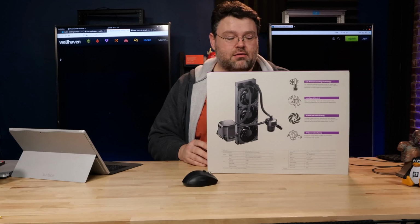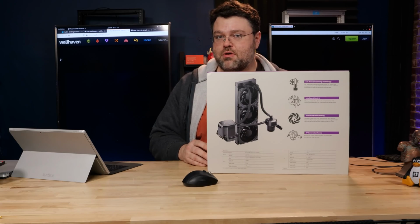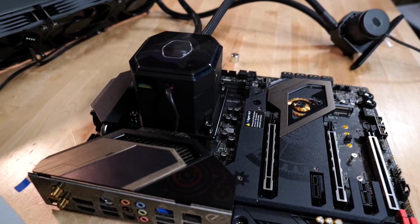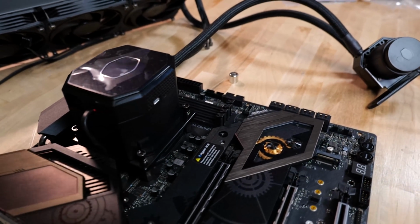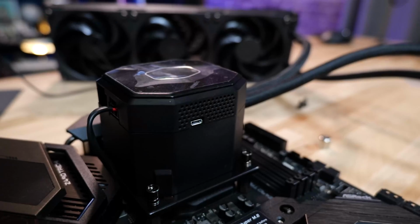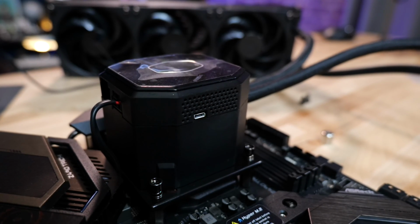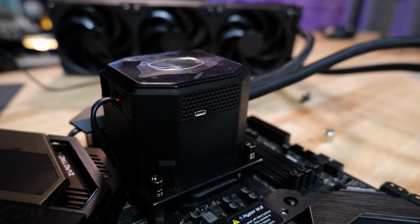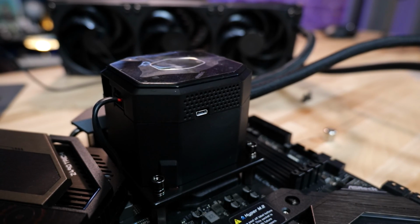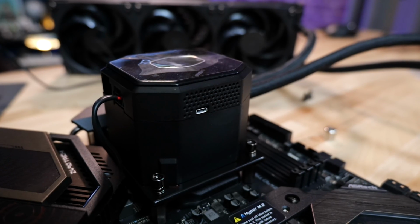But you can boost your single thread clocks. You're going to be dumping a lot of watts through that 14 nanometer process into 1 or 2 or 3 cores. If you want the land speed record for CPU single clock and you don't want to go liquid nitrogen, this is probably for you. So this is a product for somebody that is pushing the envelope and not afraid to murder your CPU, or somebody that just wants to run their CPU at sub-ambient temperatures.